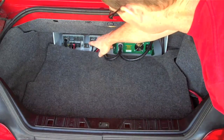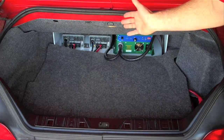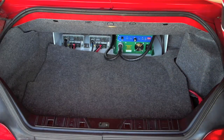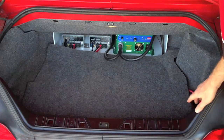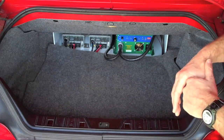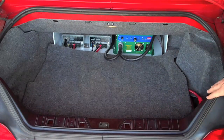The two components you see over here are the DC to DC converters. Those are supposed to be able to deliver 55 amps each, but in truth what people have found is they really only can deliver about 45 sustained, maybe 55 peak. The problem is that the power steering pump can actually draw up to 85 amps on a hard lock, so clearly one of those wasn't going to cut it. So what I did is I got two and I wired them in parallel, so together they both put out a combined 90 amps if necessary.